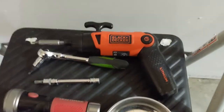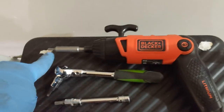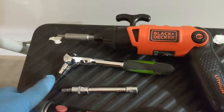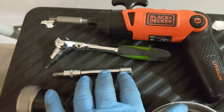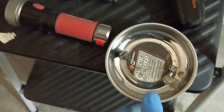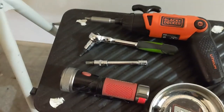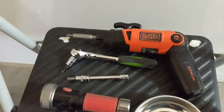The tools I used for this project were an electric screwdriver, T20 Torx bit, quarter inch drive ratchet with T20 as well, a little extender for some points, T30 for removing the headlights — everything else was T20. A flashlight is really handy, and a magnetic tray for the screws. You can use probably any variety of T20 and T30 that you'd like, but those are the ones I found really helpful with this project.